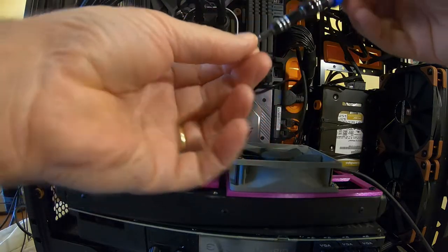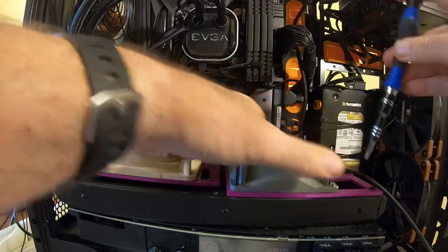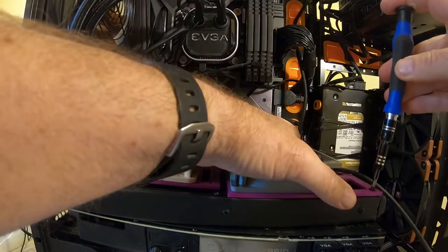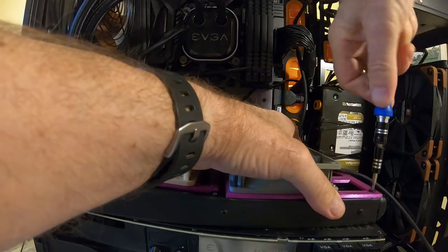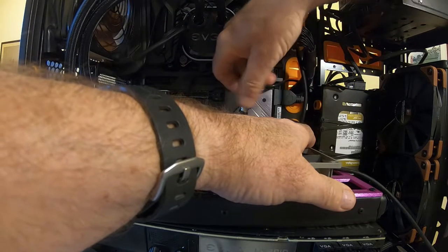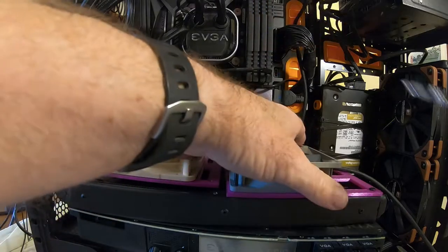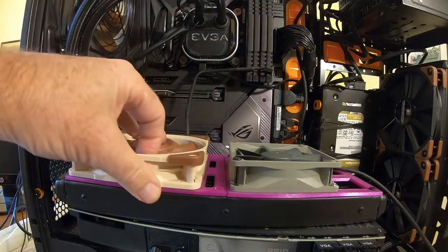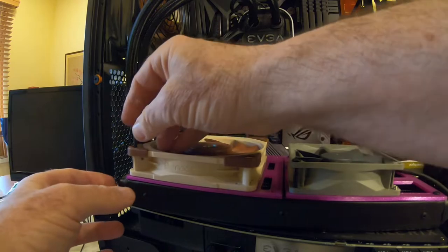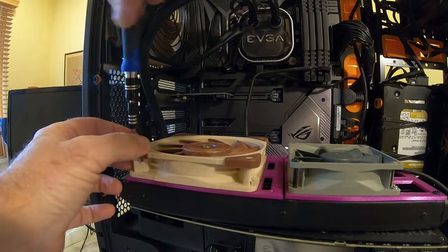There's some vibration obviously with the fan turning, so we don't want these screws falling out. We're going to get all the screws in and then tighten them up a little bit more so they're snug — we definitely don't want these coming out and dropping down into the computer somewhere. This PETG filament is very resilient — it's the same stuff that 2-liter soda bottles are made out of, so you know it can handle flexing pretty well. We've got one screw that goes all the way through the fan and three more that go through the adapter.